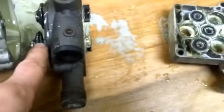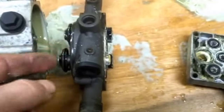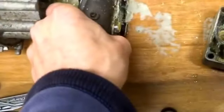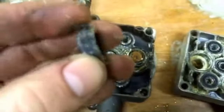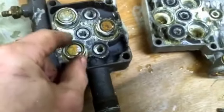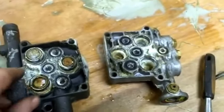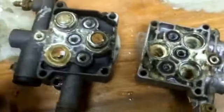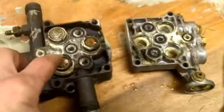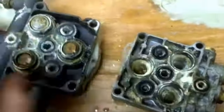The other thing that can happen is these pistons can jam forward — pushed to the end of their stroke. Because they're only returned under spring pressure, if they can't come back under spring pressure they end up stuck and not pumping. Check that these aren't stuck and are actually running freely. These often have a ceramic seal on them; this particular type has a rubber seal. These seals are replaceable — if the pistons are stuck or the seals have broken down, that'll stop it working.